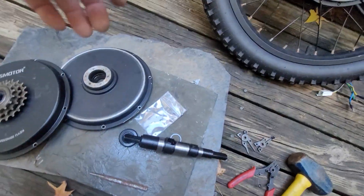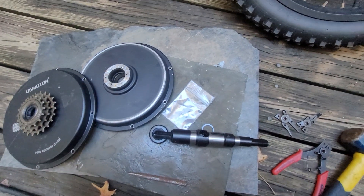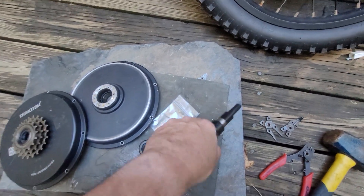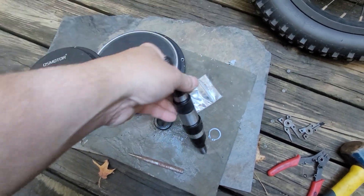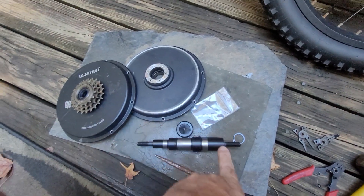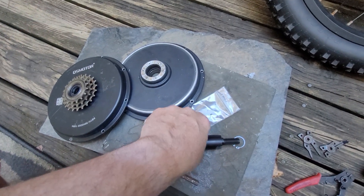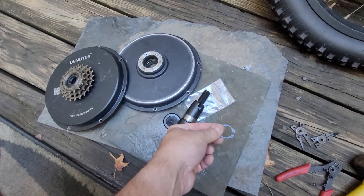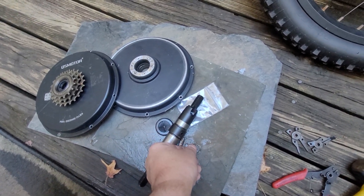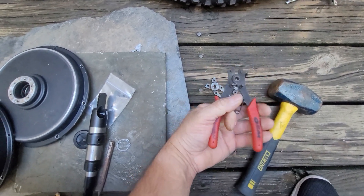What it do, e-world, crisscrossing wires. I'm going to show you a few things if you ever attempt to swap out one of these axles, just so you know what's involved. Obviously you have to remove the dust covers first of all, and then there's one of these little rings that locks the axle into the hub, and you're going to need one of these little tools like this with the different ends.